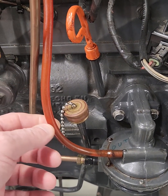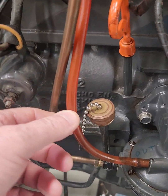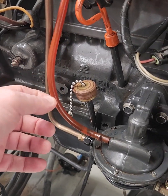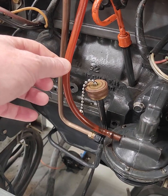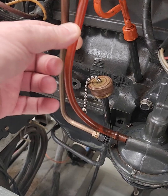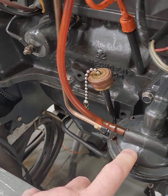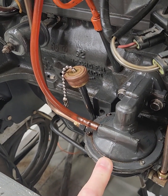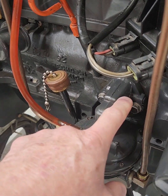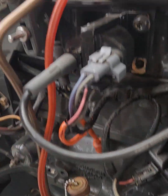This is the third hose he's talking about. It's an opaque, yellowish-orange hose, probably from the early 80s. It's a plastic kind of hose that's usually soft and supple, but it's hard and brittle now. That means the diaphragm inside this pump has started to fail, and it's allowing alcohol-related fuel to come up into this chamber, which would ultimately go into the engine.